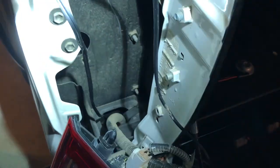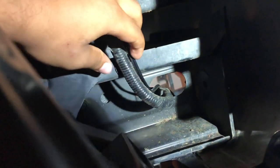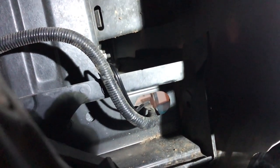As you can see, the standard connection is right in here. We've successfully run the wire. We're up and under the truck, and for added protection and peace of mind, we're going to zip tie our wire to this wiring loom right here — the factory wiring from Toyota for the tail light. We're going to do that just in case something comes up and snags this wire. It's just a smart idea to zip tie it here so this wire doesn't move, because remember we've got a lot of slack up there.